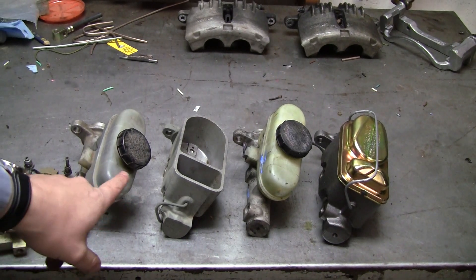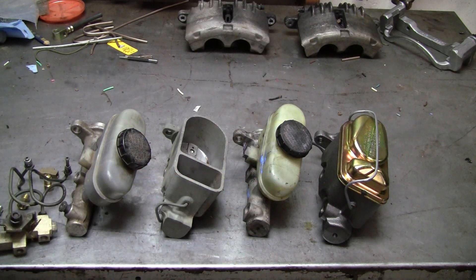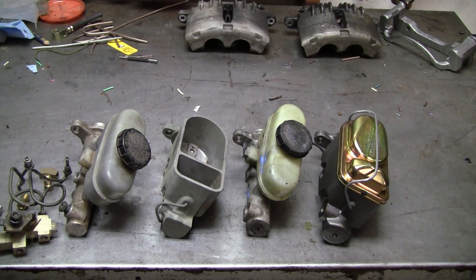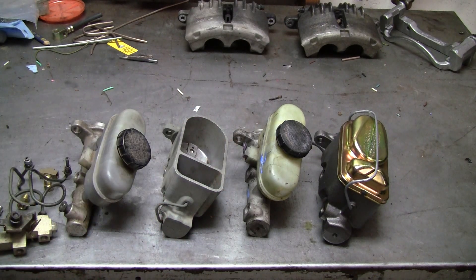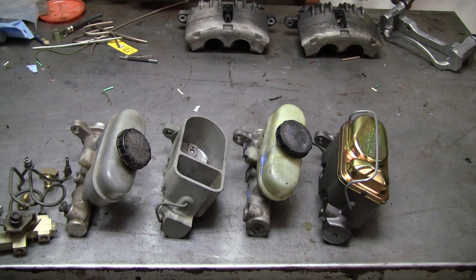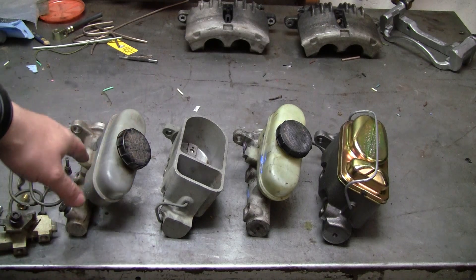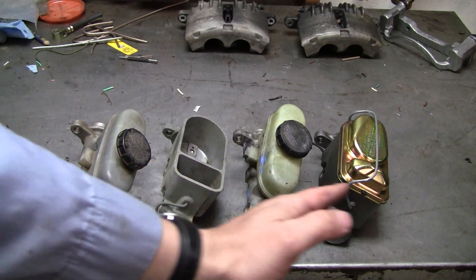If you've got an older car, do you have to use one of those older master cylinders? No — you can use any of these master cylinders on any Mustang 79 to 04, excluding the later 4.6 hydro-boost cars. The advantages and disadvantages come down to bore size and whether you care about the low fluid sensor. For brake upgrades, you're likely moving to larger calipers and need to push more fluid for correct pedal feel, so you need to move up in master cylinder size. The 21-millimeter bore — or whatever your 79 to 86 has — isn't going to push enough fluid and won't work for your upgrade.